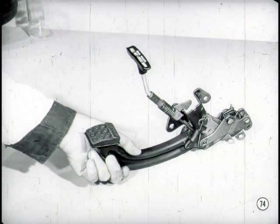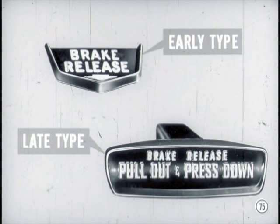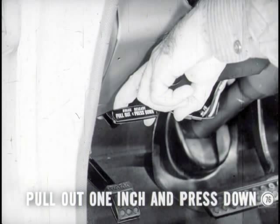So much for service brakes. Let's talk now about the parking brake. There's a new, improved brake-release mechanism used on late-production cars — this applies to all models except Valiant. It's easily identified by the new release handle. Although there are other minor changes in the release mechanism, the parking brake is applied in the same manner. To operate the latest type release handle, you pull it out approximately one inch and then press it down. But how about adjustments? Adjusting procedures are the same, but let's review them. You might get some reports of a pedal that requires a lot of pressure, or of a binding or crunchy feeling when engaging the brake.